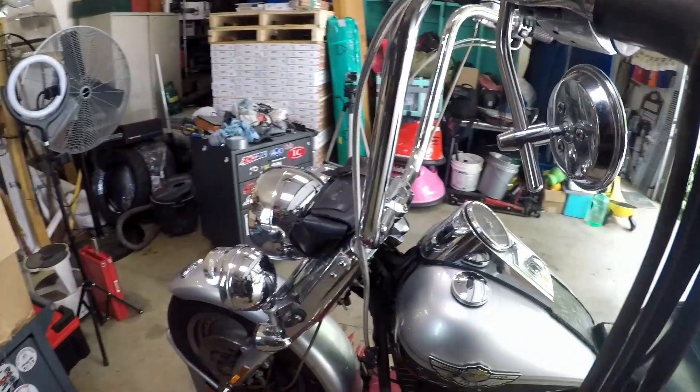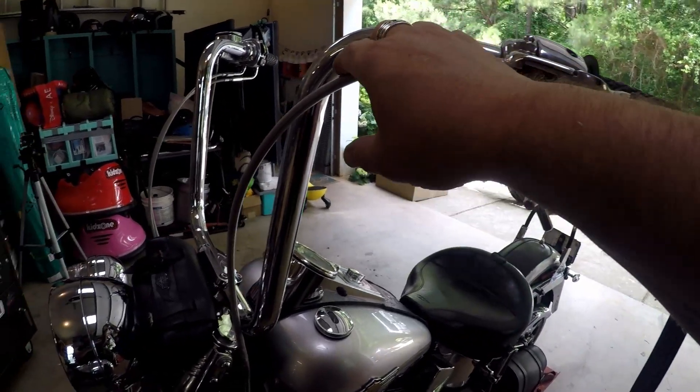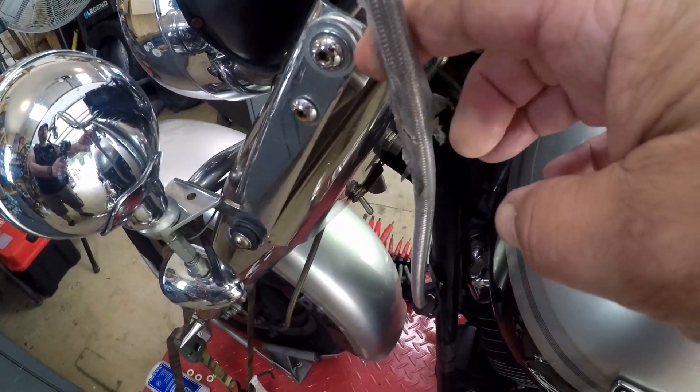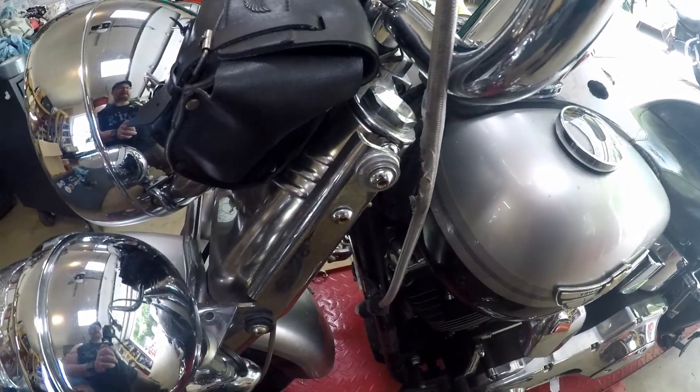So that covers the upgrades over the years on Miss Piggy. I did take off the Harley stock mirrors — I got inspired by Ozarks Rider HD and his Sucker Punch Sally with that sweet little circular mirror, so I got the same for Miss Piggy. The aftermarket braided cables are probably 15 years old. The braiding's plastic coating is worn out — this clutch cable probably has close to 80,000 miles on it, so I'm anticipating it breaking any day now.